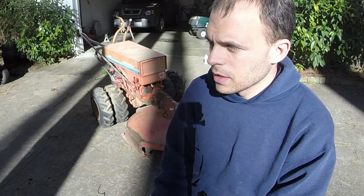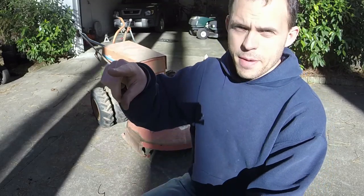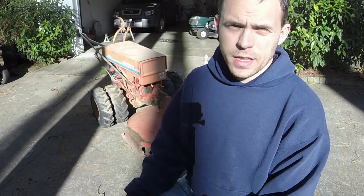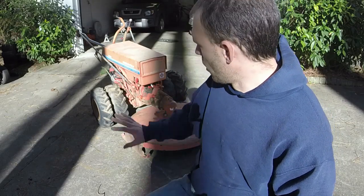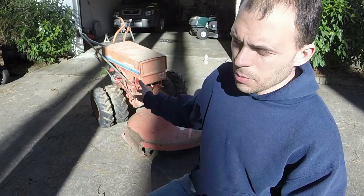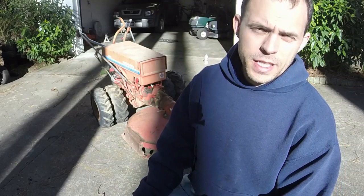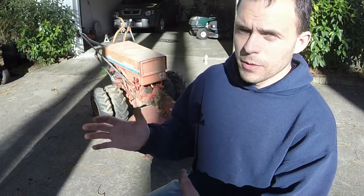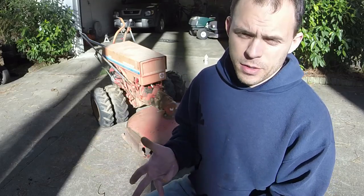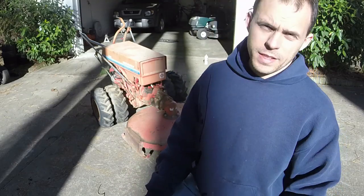And I pulled this onto the trailer with a come along. It was in that much dirt from where the dirt had kind of washed underneath the barn a little bit. And all four tires were flat. I wish I'd have filmed it. And like I said, we brought it on the trailer, got everything freed up. We put a battery in it, tried to start it. It was flooded out with the fuel pump, put a fuel pump in it, new fuel lines, tried the carburetor. Carburetor didn't work. Put the original carburetor back on, and here's what we have. A nice working Gravely Bush Hog.